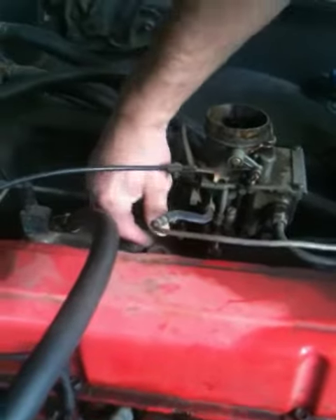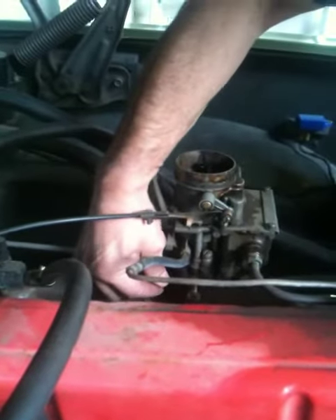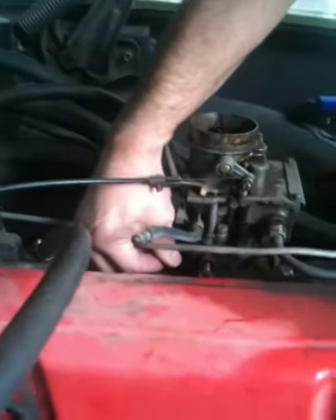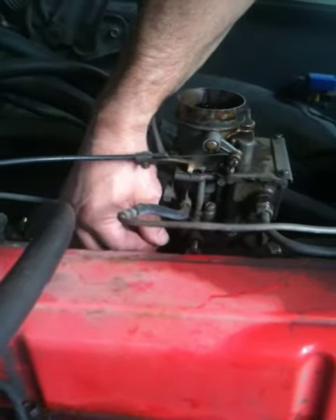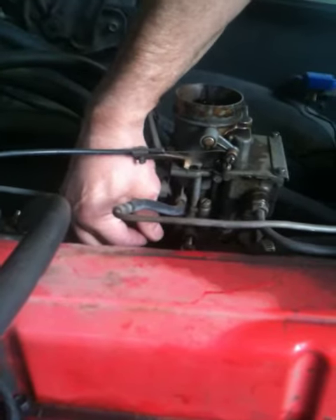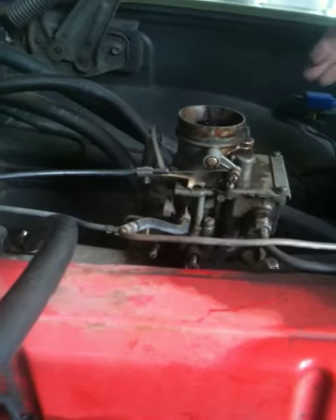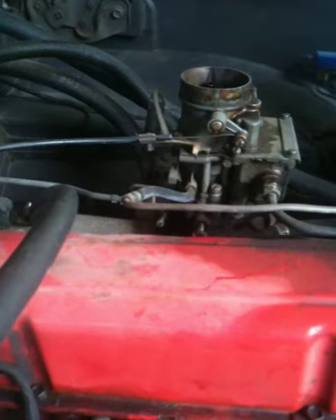Can you see my fingers doing that? So that is way too high. The way to set the idle is to actually use a tachometer. Most cars have got a tacho on the dash, so you can set this screw according to whatever the gauge sits inside the dash, or if you've got a portable one, or you set it by ear like I just did.